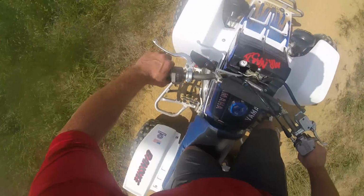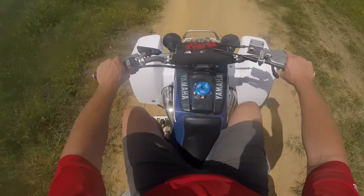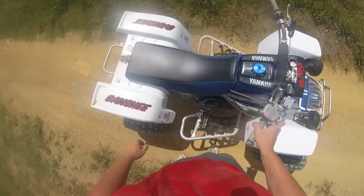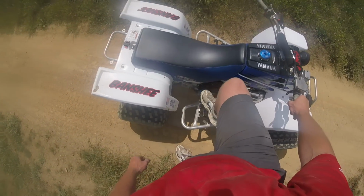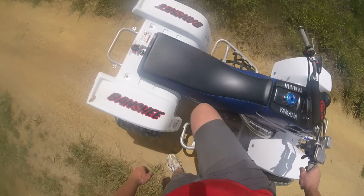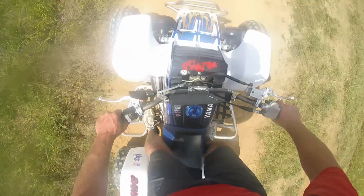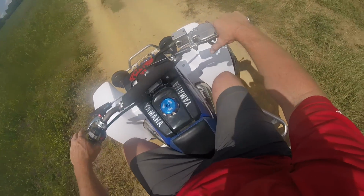First thing I don't like. Notice this when I put this engine on it. And this ain't that big of a deal, but it's kind of a little pet peeve. Kill switch is on. No throttle. Will not crank. I've tried everything as far as adjusting everything on it, but watch when you crack the throttle. It'll fire right up. May just be a Cub motor thing.